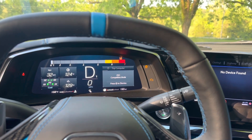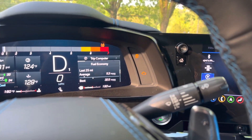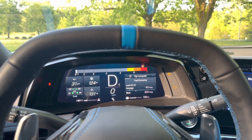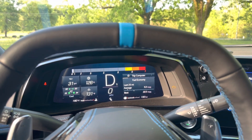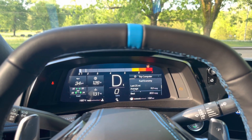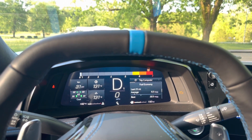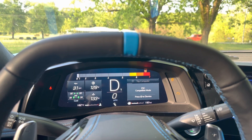So you go one, two. You see those two lights up there — you're going to have to have both those on. Disregard the check engine light, that's not important. You have to have both those lights on before launch control will actually activate. If you don't have both lights on, whenever you go to foot brake it the RPMs will only go up to about 1500 or 1600 RPMs, but whenever you have both of them on they will go up to 3500 RPMs.